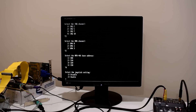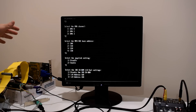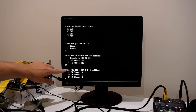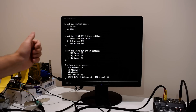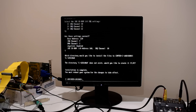Now it asks us for the optical drive, and you have to try out a few options. What happens is if you choose an option and the resources don't work, it will just hang, so you might have to try again. In my case option number two worked, and for the interrupt for the IDE controller for the optical drive, option number one — which is interrupt 10 — worked. It lists all the specifications; just press Y to confirm. It asks us to enter a directory to install the drivers, so I'm going to put them in C:\ESS1868. It asks if the directory doesn't exist, do you want to create it — yes. Off it goes, and now we just have to reboot our machine.